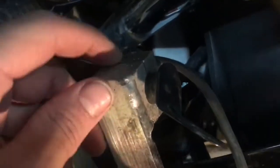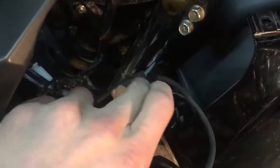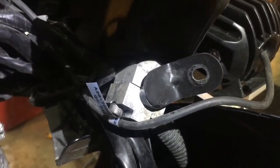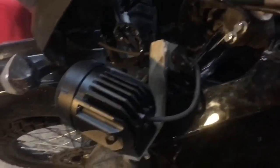This is the bracket. Basically it's just one inch by quarter inch bar aluminum. This bar stock — I have a friend with a milling machine — so we milled this out and made a little clamp here. This is the other attachment point for the plastic, and this just clamps onto that. This is a five-eighths rod, so this has a five-eighths hole in it and two screws through the back. You can see the five-eighths hole, and I've got two Allen screws in there holding it all together. These are quite adjustable. I had them made with the flat bar stock straight, then I bent it up to where I wanted it. Overall I think they're a nice little mount. I'm even thinking of patenting this and making a product out of it, like Eagle Mike.